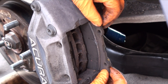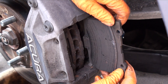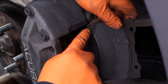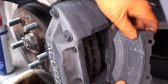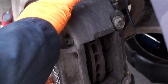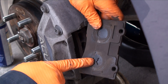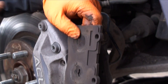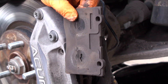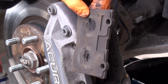Once the pistons have been retracted back into the caliper body, remove our pads. These pads here are actually directionally oriented, so you want to make sure that when you're removing the pads, you pay attention to what the old pads look like. The wear squealing tab is actually on the back pad, whereas the front pad doesn't have any squeal tabs on them. You can see on the OEM Acura pads there's even a directional arrow to indicate which direction the rotor rotates and enters the caliper body. Driving forward, the rotor is rotating clockwise, and conversely, the pads indicate that the rotor should be passing this pad in a downward direction.